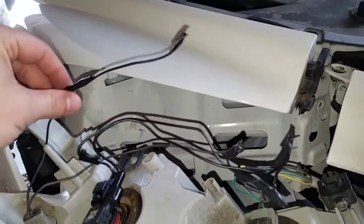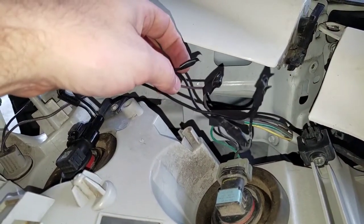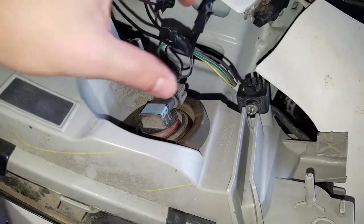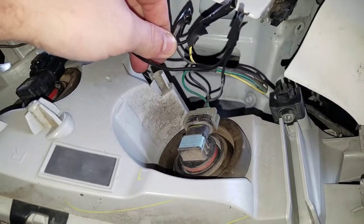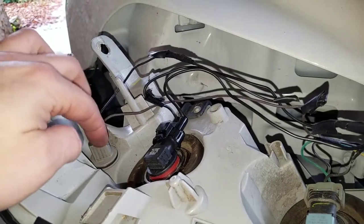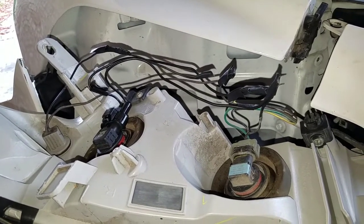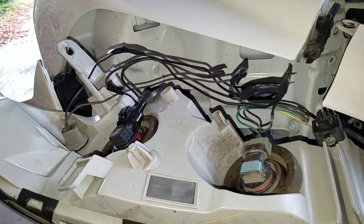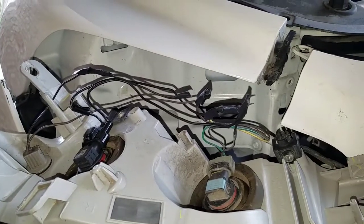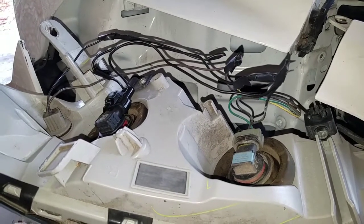I'm back. That's what I did — this one I just left undone, and I patched the two brown ones together, then patched the two black ones together, and kept the other black one with the yellow one. The one I left undone was connected to this one. And everything works. I checked my regular headlights, just the driving lights. I replaced the fuse in the trunk for the driving lights and parking lights. Changed that, put the battery back together, started it up. My headlights worked, the brights work, the blinkers work, the hazards work, the brake light works.